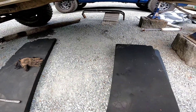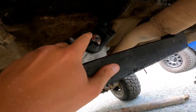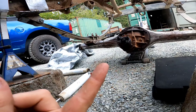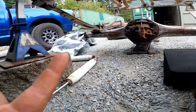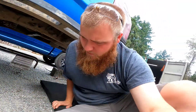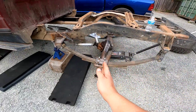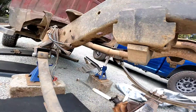Measuring for the driveline comes up to 64 and 5/8 inches, measuring from the flat face on this yoke to the flat face on that yoke. I measured at ride height and then full droop — obviously there's no tires on there. But it actually gets shorter on full droop, because the axle is dropping down and forward because of the way a shackle works. That is a pretty long driveline, so I'm going to have to call Monday morning and get a quote.